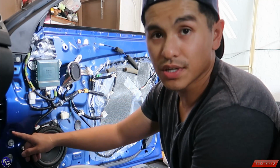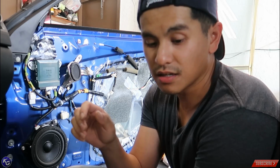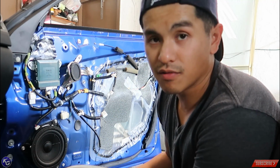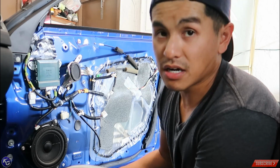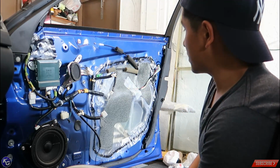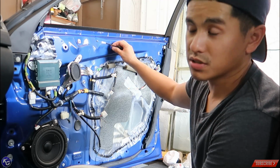Before we go ahead and put the new one on, you want to make sure that all of these holes right here don't have a clip stuck in them, because it's going to give some issues. You're better off trying to pry that plastic off with some pliers and put it back on the door panel before you slap it in. So just doing a quick look around. In terms of these 2 connectors up here, the green one is the bottom, the white one's the top.